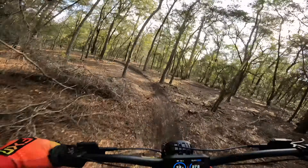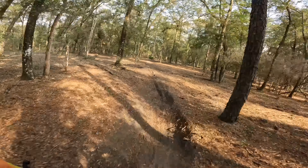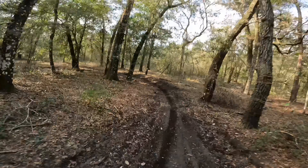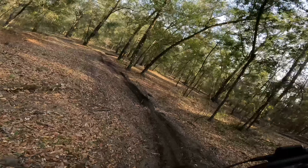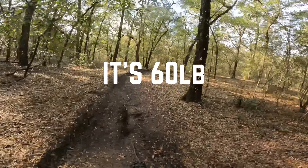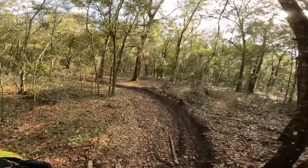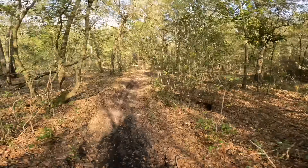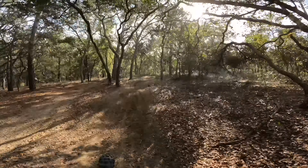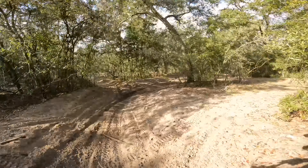The other thing is this fork feels so much better — not that it felt bad, but that plush tune with the 50 pound spring was not enough on this bike, especially for this type of riding. I'm back down in Florida and we're riding some whooped out stuff, so definitely some harder hits. I've got the 60 or 65 pound spring — I can't remember which off the top of my head — but running that and the aggressive tune from Charge Cycle Works is a really nice combo, especially for what I'm running down here. Pretty impressive what you can get out of such an affordable fork. The bike feels way more balanced right now. I'm very impressed with this fork.